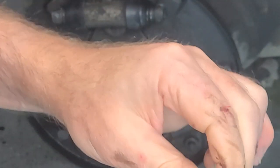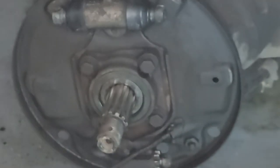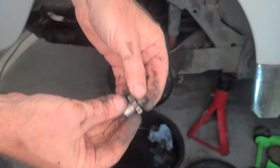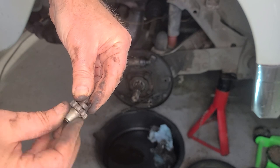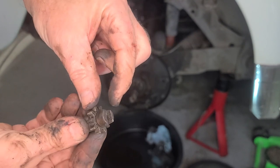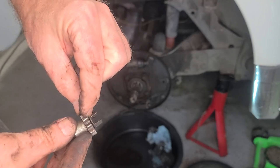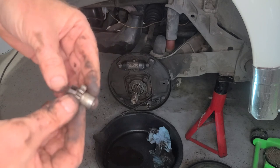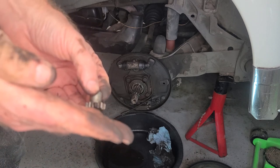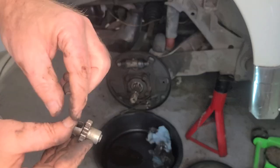These aren't exactly rusted but they're not freewheeling, so I'm going to give them a little attention to get them all the way down so we have enough room for the new shoes. We're freewheeling now. One thing when putting these back in place - notice there's an angle cut into this landing. The short end goes up. When the shoe sits in, it'll sit at an angle, and when you advance them they'll ride on that angle. Short end up.